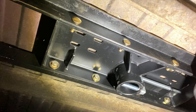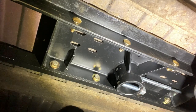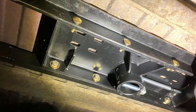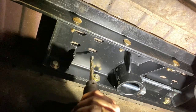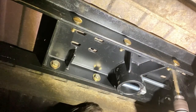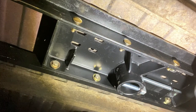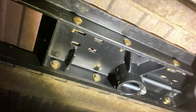The last thing we gotta do is drill the holes for the safety chain latches. It gives you two options because it knows that beds are ribbed — find a low rib on the bed and drill the hole before it so you're not crushing the bed with the chains. I think these holes are gonna be my winner. I'll go with a half-inch hole. Then we go up top, drop the hooks through, and the bottom has a spring on it that keeps the hooks sucked down until you need to use them, so I can drop them in through the top.